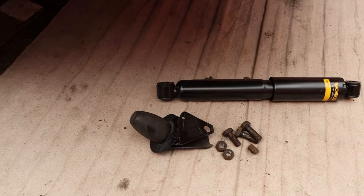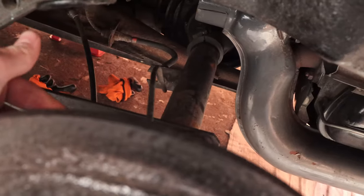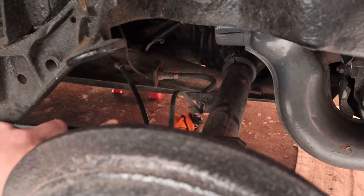It's a new day. I'm just bolting everything up now. We still have to sort a few things with the petrol tank and fuel lines, and hopefully that solves the bogging in first gear and the bogging at higher revs when you put your foot flat. Sounds like a fuel problem — we'll see. If not, back to the drawing board. Got the new shocks, the bump stop, and just need to put three bolts in and figure out how to make the bump stop so it doesn't hit when the car's on the ground.